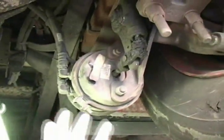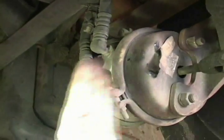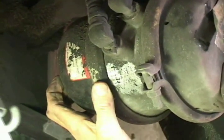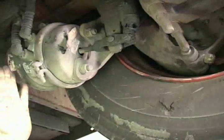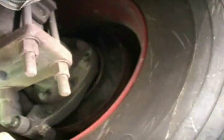Once we've looked at the suspension, we're going to inspect the brake system. This is a dual air brake chamber and it plays two roles. This side of the air brake chamber is for the normal service brake, and this side is your parking brake or emergency brake. When you apply the parking brake, you're releasing the air pressure from this side of the chamber. There's a large spring here that drives this rod forward and locks both rear wheels. When you apply air pressure, it compresses the spring and allows the normal brake to operate. This device turns the linear motion of the air chamber rod into a rotary motion and squeezes the disc brake pads against the rotor. This is a disc brake truck, so it has a nice shiny disc in the back with no evidence of oil or grease leakage.